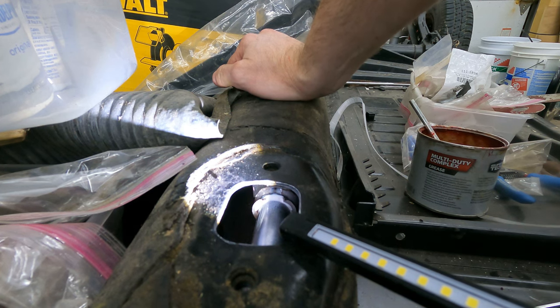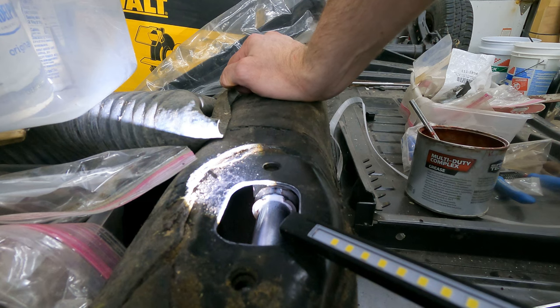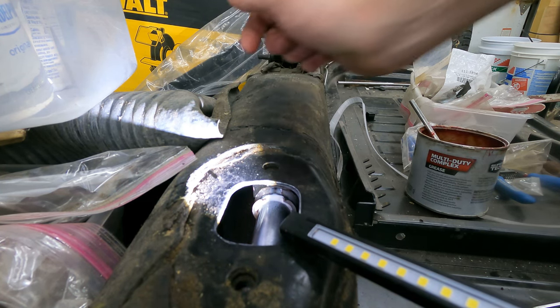Well, I couldn't give up. So I did a little research and I'm pretty surprised - this bushing is from Wolfsburg West, which is supposed to be the best quality plastic bushings available. I didn't get the spring clip from Wolfsburg West though; I got the spring clip from J-Bugs. What ended up happening is the J-Bugs clip was too tight, so I stretched it out just a little bit. That gave me the right amount of slack to be able to get the rod started, and now it's in there. So now I've got to get the rod pushed all the way to the back, which is a challenge in itself. I'm using white lithium grease in a spray bottle to help it along.